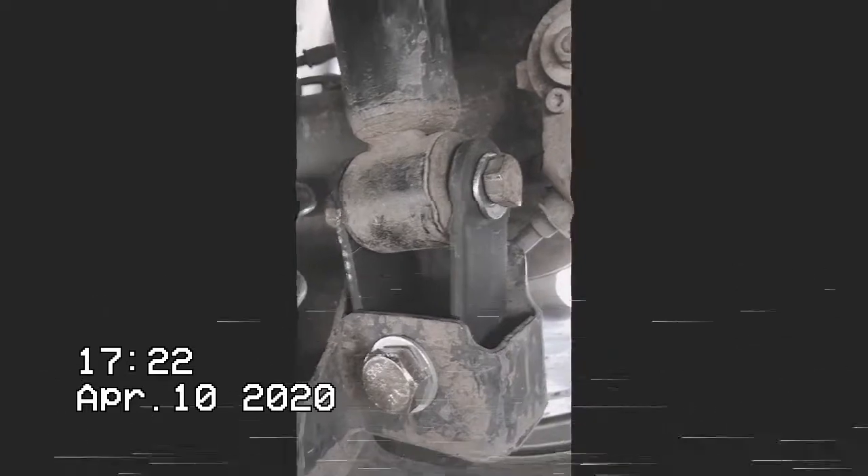I drilled out the bottom hole bigger for the bolt that came with the unit because I didn't want it to rattle with the small bolt. Then I could use the bolt with the stock shock so it won't rattle, and it's an interference fit like I showed in the previous picture where it's bent, but it'll be fine. I've been driving it for about 10,000 miles with no spacers.